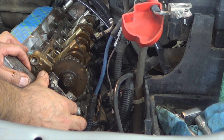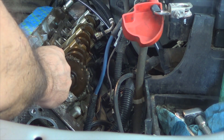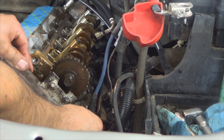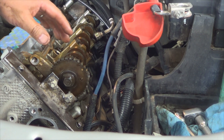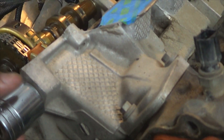This tool will definitely help me when I'm installing the timing chain, because I'll know for sure that these sprockets are where they need to be. You don't have to make a tool like that, but I made it on a previous job when I didn't have a compressor to compress the springs — it was crucial not to allow the camshaft to move when removing the head. Next, remove the right hydraulic tensioner and remove the bolt with the T40 Torx that holds the lower guide, then slide this guide out.